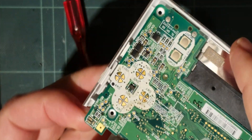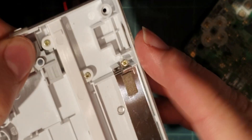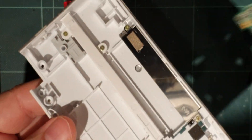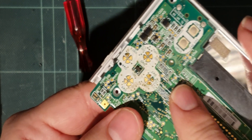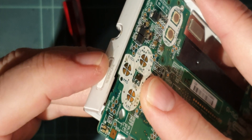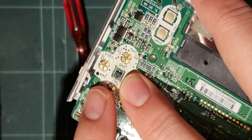If when you put your DS back together after changing the shell, you've done something that is not pointing towards the front of the machine — this is the front of the machine — that switch needs to be pointing at the front. If it's at the back, what happens is as you put the case back together the switch goes the wrong side. That stops the slidey from working. And if you force that slidey, it's going to break that switch off — break the plastic bit of the switch.